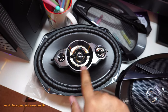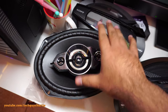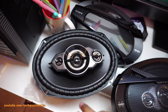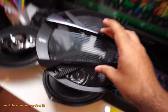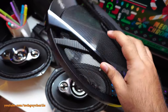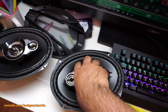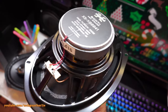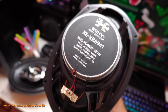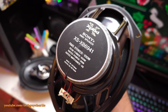I absolutely love the front shroud — beautiful design by Sony. You might be able to tell these are old-style speakers meant to go in the rear shelf of your car. It has a carbon fiber texture on it. Flipping it over, you can see the big beefy magnet. So that's 100 watts RMS and 650 watts peak — I always urge you to ignore peak power and look at RMS.